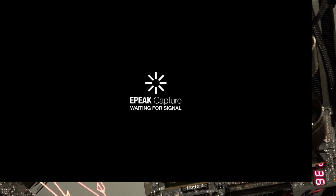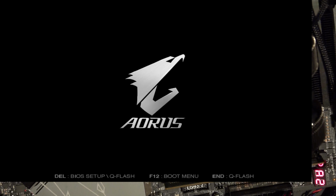You know what would be really funny if the performance drops again? That would be peak 11th gen right there. Just boot the same setting twice, get drastically different performance results. There's a whole other issue with 11th gen where if you boot the same settings twice, you get drastically different stability if you're really pushing the memory frequency high. Which is basically why I haven't had a super high frequency overclock video with the 11900K that was actually showing stable settings, because every time I've tried really high frequencies, it would randomly be stable or unstable.